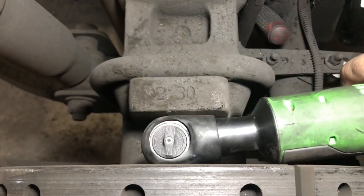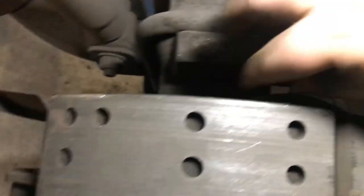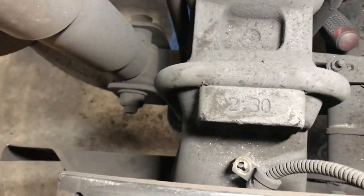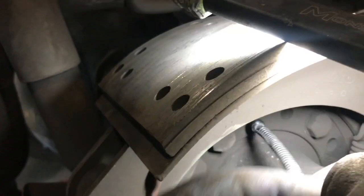I am going to clip the zip ties right here — only 2 zip ties. I am going to take this little bracket off. We are going to get this harness through. Here is the ABS sensor. You just need to tap it out — you can push it out with a pry bar or tap it with a hammer on the back end. I am going to pull this wiring through the back of the hub. Got it out.